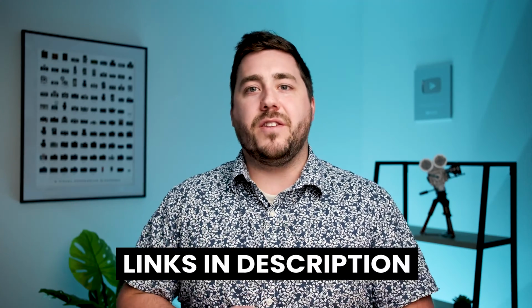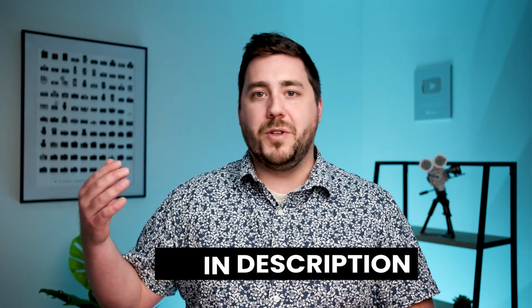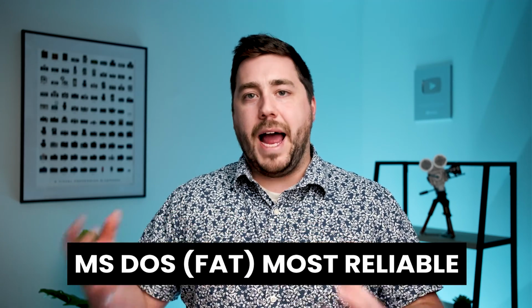Now, if you want to use the drive with Macs or PCs, we're going to want to go with exFAT or MS-DOS FAT. Now, I left some links in the description because I think some people will want to do more reading and exploration on this, but I'm going to break it down fairly simply. MS-DOS FAT is going to give you the most reliability and ease of use between Macs and PCs. The problem is MS-DOS FAT has some very big limitations in both the capacity of the hard drive and the types of files we can put onto it.